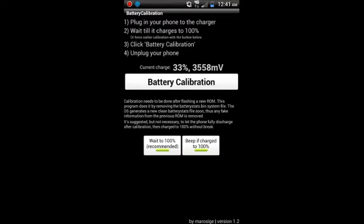You plug in your phone, let it charge up to 100%, and then all you do is click the little battery calibration button there and unplug your phone. Basically, this just deletes your battery stats.bin system file — wipes that out, clears everything. A lot of times when you flash new ROMs it messes those things up, and you need to wipe that clear to refresh the system and let your phone know that all is running well again.